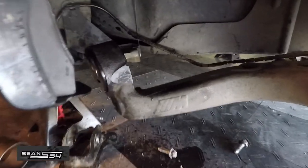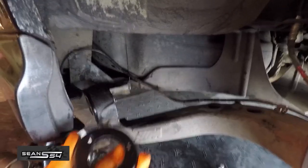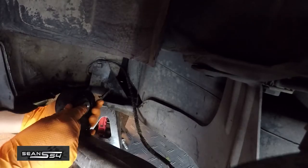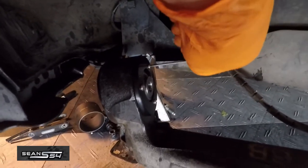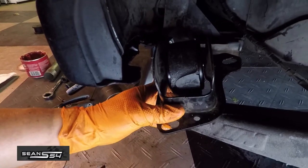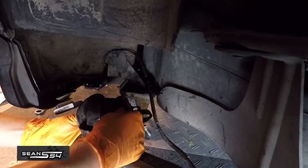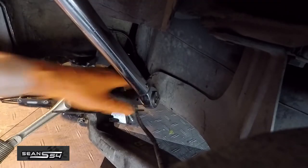That's it, we got it. The rear trailing arm bushing is fully pressed in — it's nice and flat. Now we're gonna put this cap on. You tighten down these little screws to five foot pounds, which is basically nothing. Then we're gonna put this back on and install the middle bolt. Torque this bolt to 81 foot pounds.